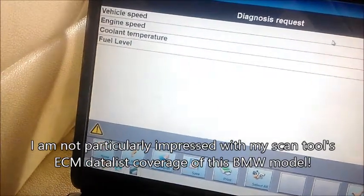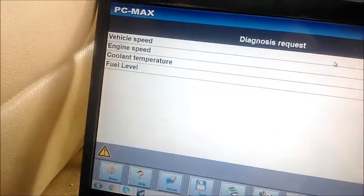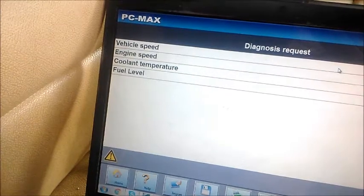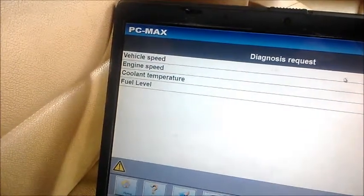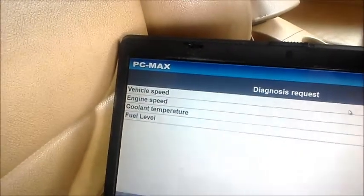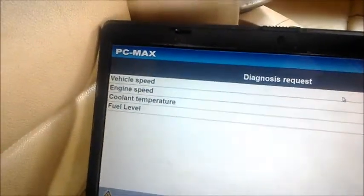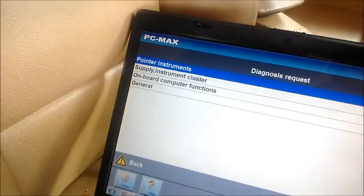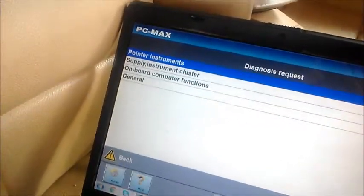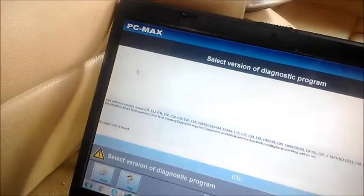What are we looking at here? Because in the instrument cluster, oil pressure says it's fine, meaning it's getting data from that sensor. But in the engine control module, the data was saying blank. Was it oil level? No, it was oil temperature. It had a blank number there. Oh, and I think that's why in OBD2 mode, let me go back to OBD2 mode, it threw that code for oil quality sensor.